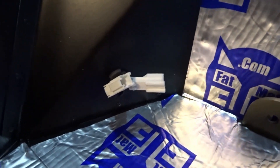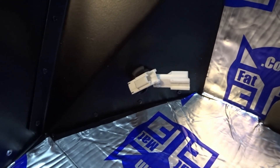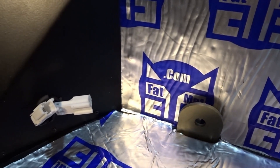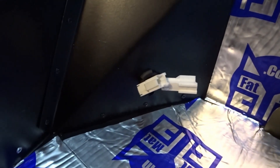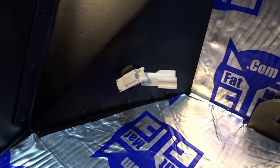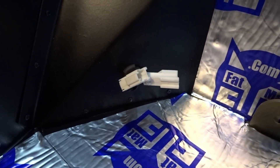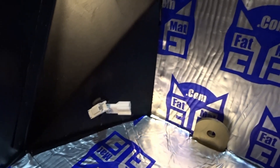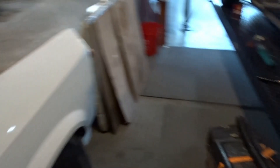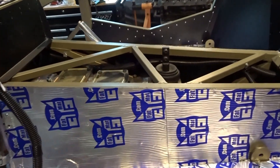At the back of the car, I've been working on getting the seat heater wires and connectors through the back cockpit wall. This is the first time I've used this location — I'm hoping it'll work out better than the sidewall location we've used before. Since I had to lengthen the wires a couple of inches anyway, routing them to here seemed pretty logical. There's more room behind the seat there. I've got the grommet installed on one side, the other side is in as well, and I've got those strapped underneath the car.